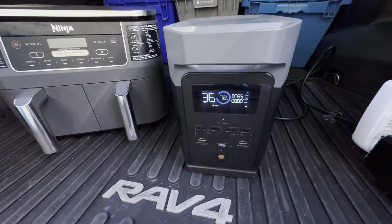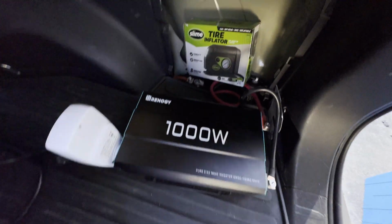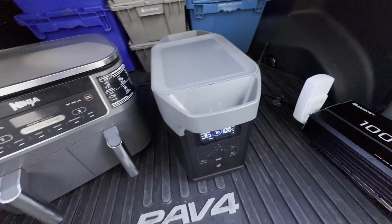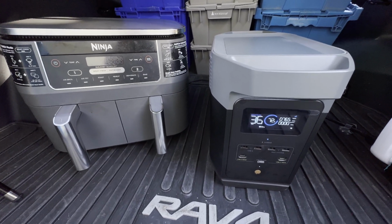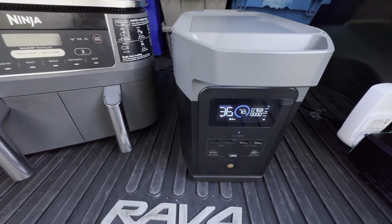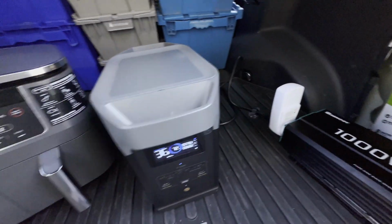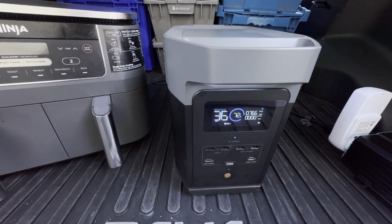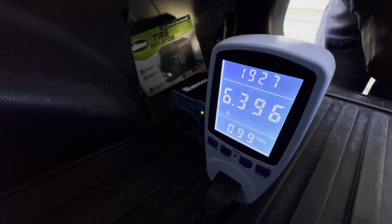All right, now the point is, again, is to not put the heavy load on the car's 12 volt battery. That was the point. That's why I have this in the center, so I can draw all my high amp and high wattage power directly from the deep cycle battery, and not the 12 volt battery. So that's my thinking. All right, so at 800 watts, we got 36 minutes to 100%. So we're only going to 81%. And that's the amps that it's drawing.